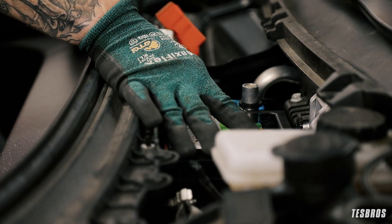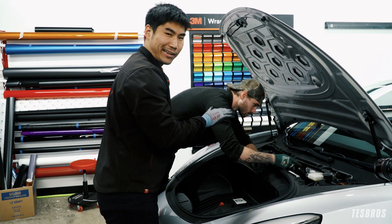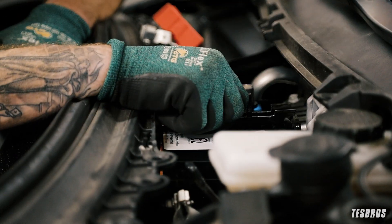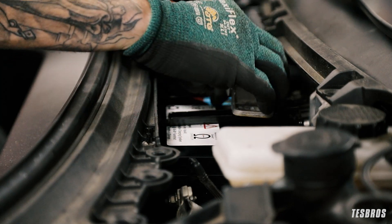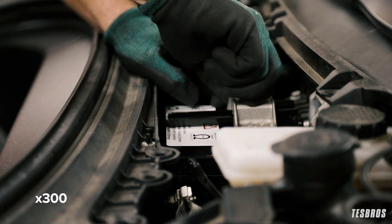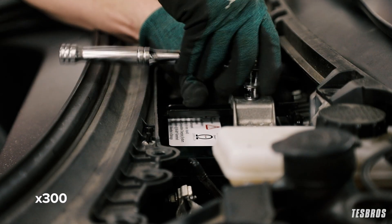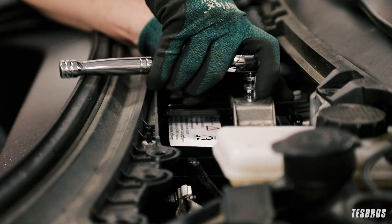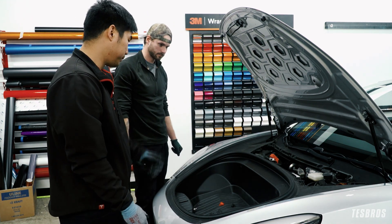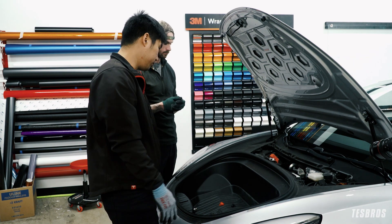The weight difference is significant — you can really tell. The old battery is really heavy; I believe they said in the video it's about eight pounds for the new one, so it's super light. When tightening the bracket bolt, you don't want to over-tighten it, but once you feel a little bit of tension you should be good. You just don't want it rattling while you're driving.